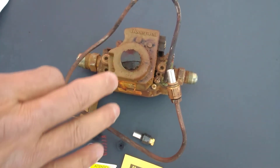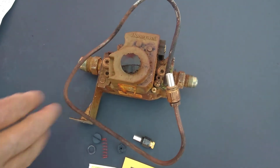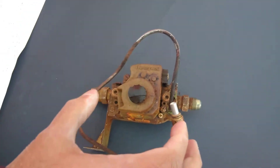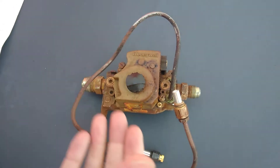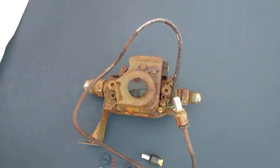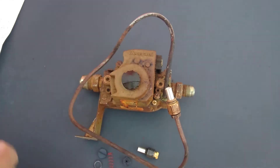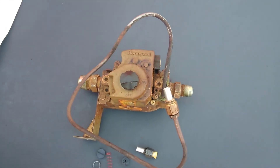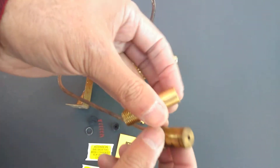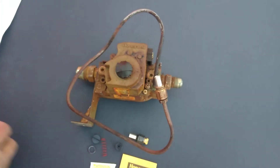You'll see this in all commercial kitchens and all commercial devices. Devices in commercial kitchens require a pilot light so that they have something to light the main flame off of. It's the standard of the industry. So in order to convert this from natural gas, which is where it's at right now, to propane, you have to change a couple of things. I've already talked about the orifices — that's going to be where the actual flame comes out and the cooking is done.